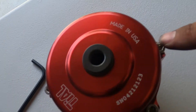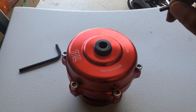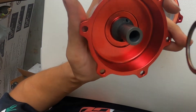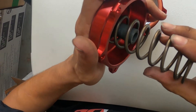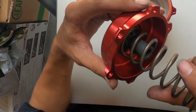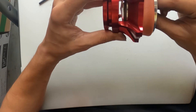First we're gonna take off these bolts to open it up and check what the diaphragm is looking like — make sure the spring and everything moves and it's the right spring. Be careful because the spring will pop up; you don't want to mess up any of the threads on your brand new blow-off valve. The spring was a little stuck — looks like a little bit of glue — so try to put it back the same way.